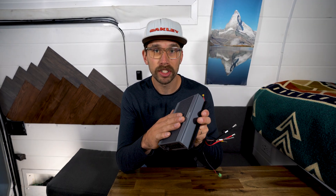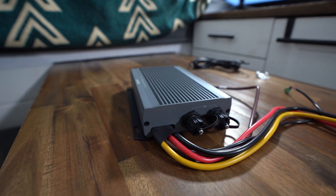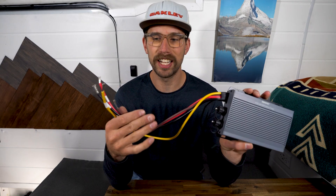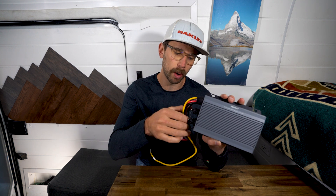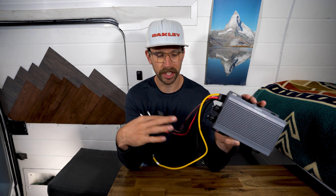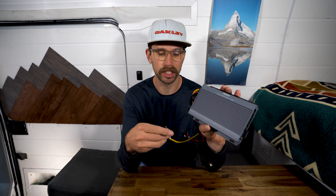The last fuse you'll install is on the positive cable going to your positive bus bar. My fuses are 60 amp for the positive output and 60 amp for the alternator, and I believe my solar fuses are 15 amp — I will link all of these fuses in the description below. One thing I'm a little concerned about is the gauge of these provided wires. I have 4 gauge running from my alternator, and I believe these wires are just 10 gauge. I might be trimming them back a little to reduce voltage loss, and I'm also thinking of connecting my wires directly together rather than using the provided connectors for a more secure connection.